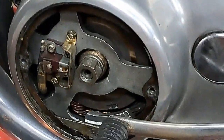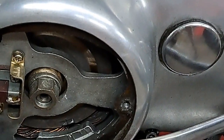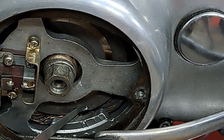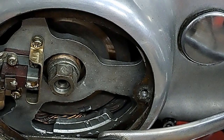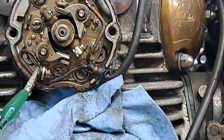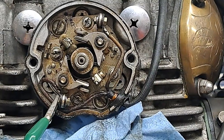We look down here. And I don't know if you can see very well, you're still on the tripod, but that mark on the rotor right there is exactly between the F marks. So I don't need to change my timing for that side.